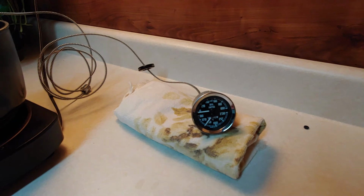I'll send that back, and I'll take it out and I'm going to test it. I've already done all this other stuff to get it to fit, and now I have to check this out. That's how I found these little washers, when I was under the dash hooking up the oil pipe. I was telling Ben, I can't get this washer to go on. It should pop over that pipe. So I got out, compared it to a couple of old original NOS ones that I had, put one of the NOS ones in, and hooked it up, and everything did fine on the oil pressure. Then talking with Mike Vincoli, he'd just done this, and his gauge was all messed up. So I gave him my other NOS and went, if this is what we got to deal with on the oil pipe, then we got to learn how to make a hole that's the right size.